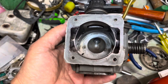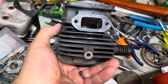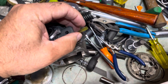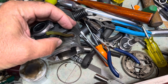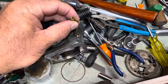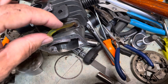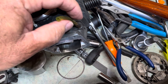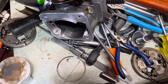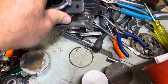The big bore is 54 millimeters — all aftermarket. I could have done a little more work on first attempt. One issue I've been seeing across several saws is this Tygon tubing I've been using. When it gets near the heat of the cylinder, it discolors and just pulls right off — it spins all around. When used as an impulse or vacuum line, it causes an air leak that was growing worse and worse.